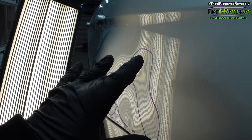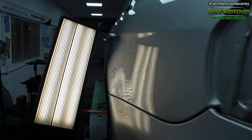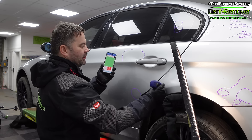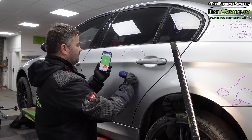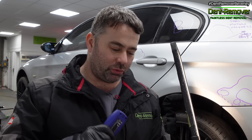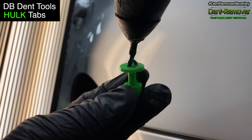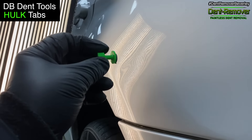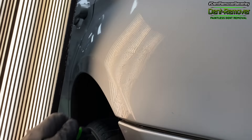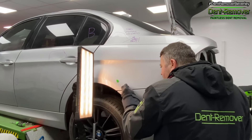All the crowns are knocked down. There are just a few more areas to pull up with the glue — I've tried to get a bar inside but it's bonded from the inside. There's a little dent there, a dent there, and a crease that goes a bit wiggly. The paintwork doesn't look original to me so I'm going to give it a quick check with the paint depth gauge. There's always a chance that hot glue might take the paint off with a repaint. The readings gave me confidence the paint is factory, so I can carry on gluing.